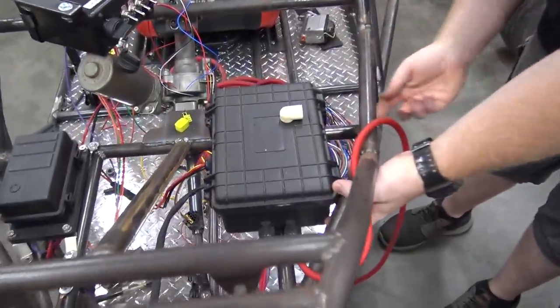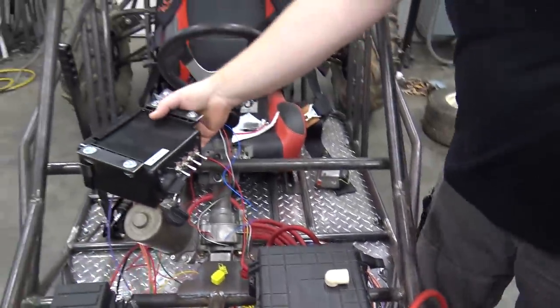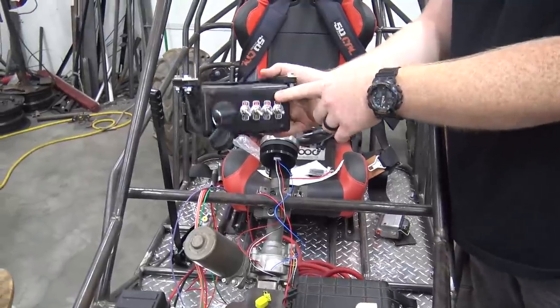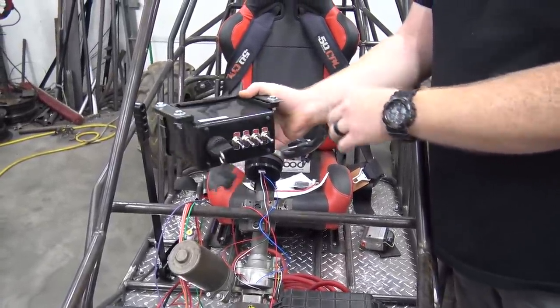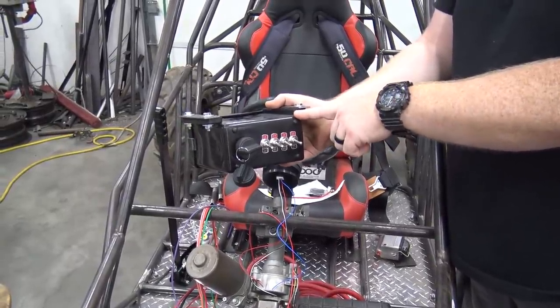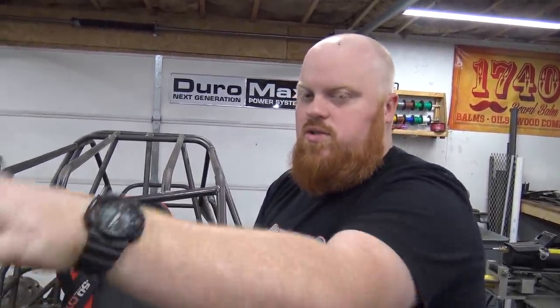No problemo. So this is how the wiring box ended up being. Everything's not done because we do got to mount all my gauges, and I've made this key switch box out of a breakaway battery box for a trailer. Trailers that have trailer brakes have a battery on board, so just in case the trailer was to come unhooked, this will send a signal and lock up the brake so your trailer just doesn't roll off somewhere.